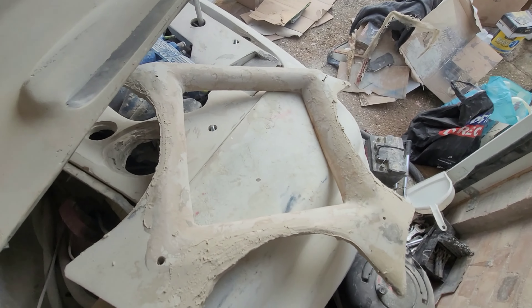I've been doing this section here as well. I haven't managed to do anything on that particular piece — left it exactly where it is — but it will have more work done this week, mainly just filler work. It does fit though, which is good — I've test fitted it. I've been doing all the fiberglass inside. I've done fiberglass inside here — I took the bar out, it's now got to be welded in at some point to hold the door. It will come out again when it needs welding, but this is all fiberglassed in now in the right shape and following the right lines, ready for the door to go in.